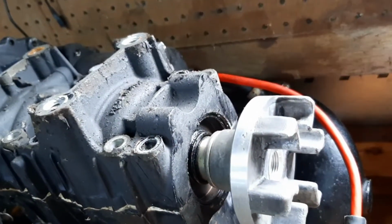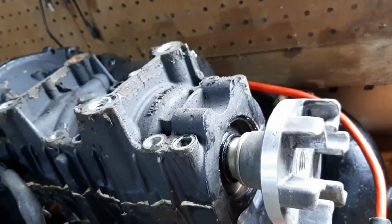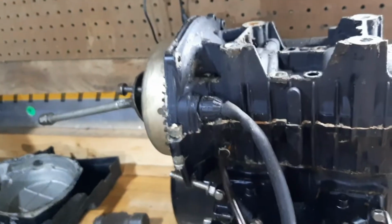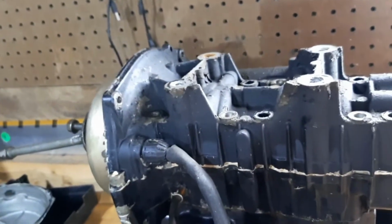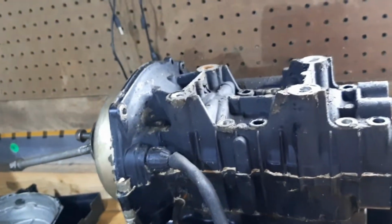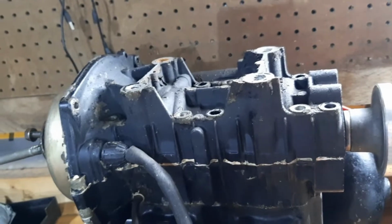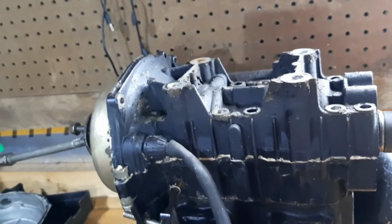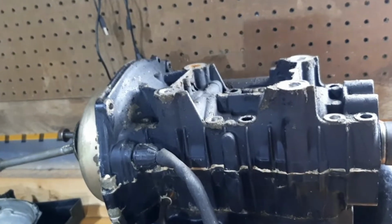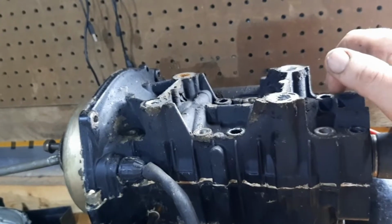I'm not sure how to think about that. But anyway, we are most suspicious of the bottom end and the bearings because of the good compression. So I'm thinking maybe the separators came out of the balls that separate the balls and they're making them jam up. Maybe it's also a connecting rod, one of the needle bearings in that, maybe getting crosswise with itself. Anyway, there isn't any machining in the bottom end, so that's good.